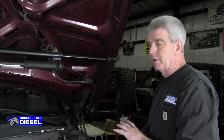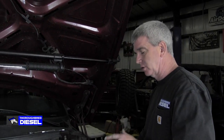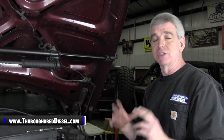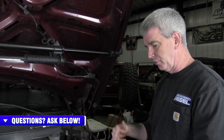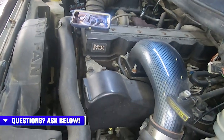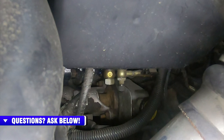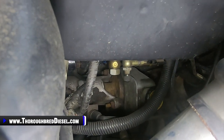Underneath the hood, we're going to show you where we are picking up our fuel pressure on this truck as it relates to it being a sort of stock configuration. We're going to be getting our fuel pressure sensor right at the inlet of the VP44. We're going to switch over to a GoPro view and show you where we're at as far as the engine bay goes. Your VP44 is going to be on the driver side of the engine bay.